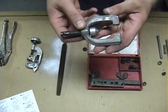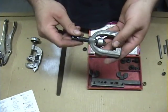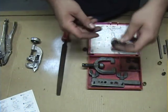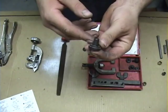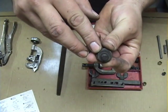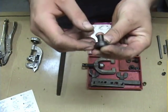You have your forcing screw with the cone — this is what you're going to use to actually deform the metal to make the double flare. And most importantly, this is what differentiates this from the single flare version of this tool: the double flare adapter, which has a little recess inside that actually catches the line and makes it force out to create the double flare.